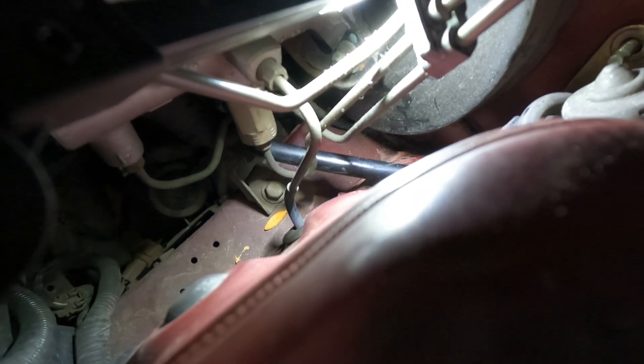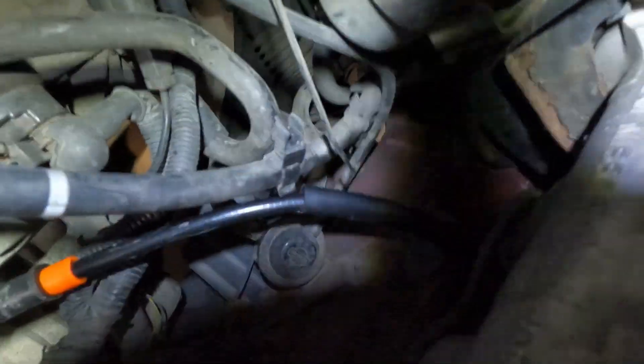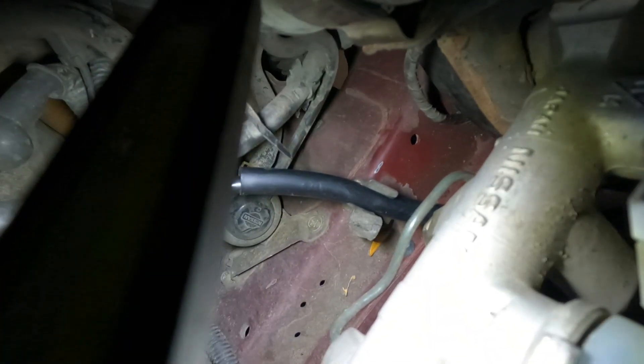Route the cable up and into that hole — there's a little cable retainer it pops into. It may be beneficial to add a little bit of lubricant to the rubber grommet that goes inside the cab. This part can be kind of difficult, but once you get in there just push hard and it'll naturally seat. Then clip your cable in, make sure your sheath moves about halfway down, and clip it into place. Make sure the sheath is covering the clip to protect it.